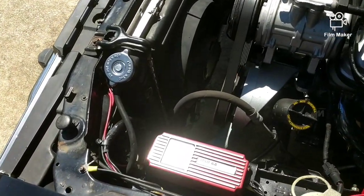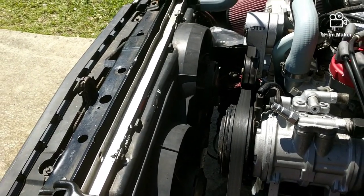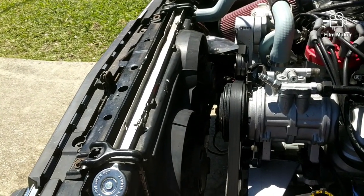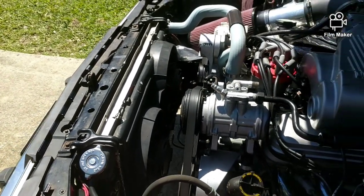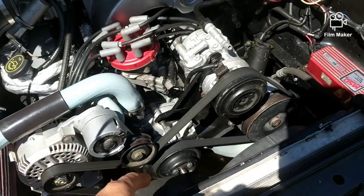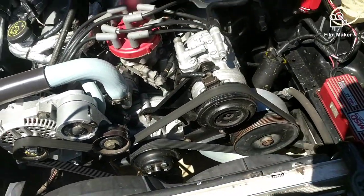Just wanted to clarify something - the fans are still running after it's turned off, the controller runs them down a little ways. With fans, typically the rule of thumb is: if it overheats at idle, your fan capacity is too low; if it overheats on the road, your radiator capacity is too low. I think the issue here is the fans are obviously not enough - the Mark 8 fan moves a lot more air than these two. The radiator is probably just marginal. I tried the underdrive pulley, the high-flow water pump, and the high-flow lower-temp thermostat - they all helped a little but not quite enough.